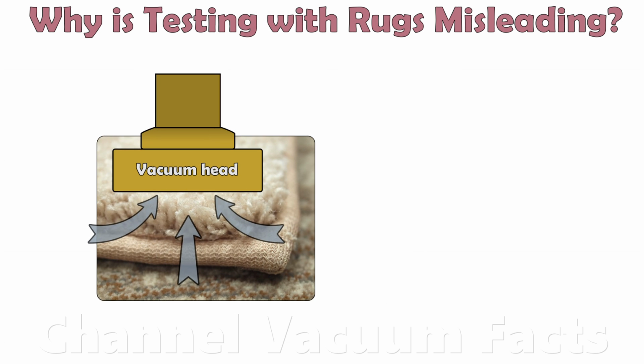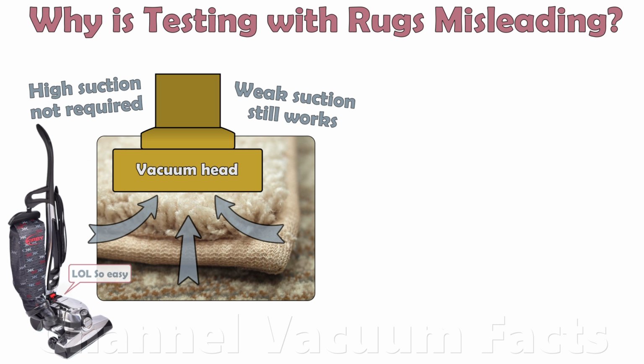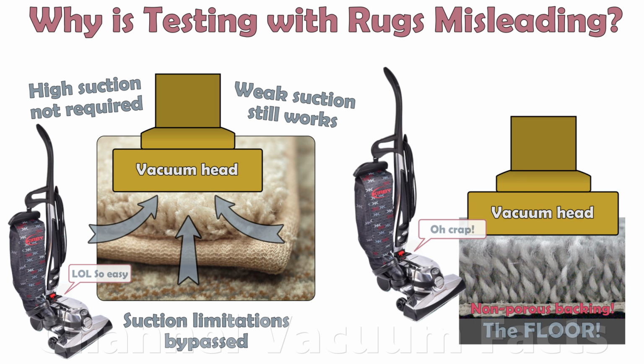Shaggy rugs offer little airflow resistance and so allow a high airflow through the pile without the need for high suction. Machines which are designed to draw large currents of air without much suction will suddenly appear to be able to perform really well, as their suction limitations are conveniently avoided. Put a fitted carpet with high quality water resistant backing in the way, requiring high suction to overcome air resistance, and they struggle to maintain anything like the same airflow through the pile.